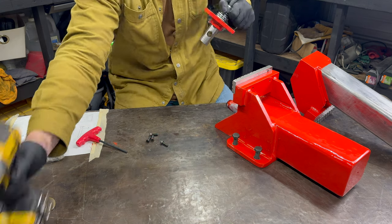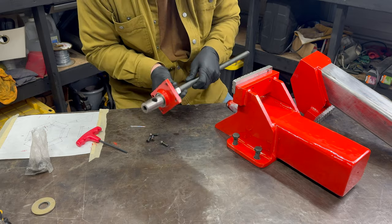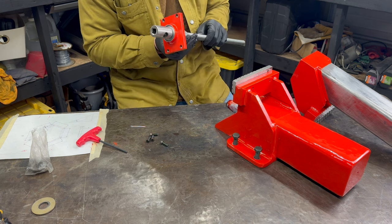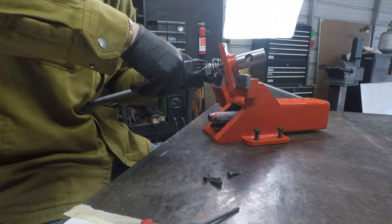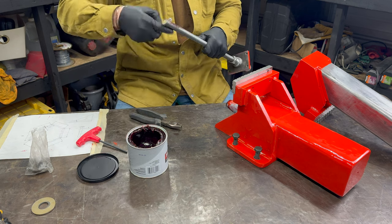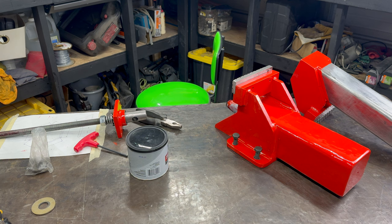All right, I actually think I have my nut backwards. Then we use a cotter pin — I have to line the drilled-out hole of my nut with the drilled-out hole in the drive thread. There we go — outstanding. We're also going to put some grease on the end of this drive thread — sacrifice another glove to get this done — make sure this thing slides real nice. All right, that should be enough grease to get us going. Let's get a new glove — that's kind of the point of using these black gloves.